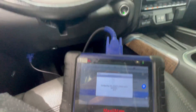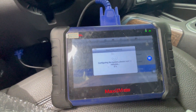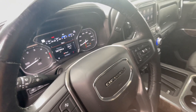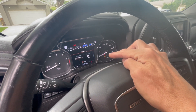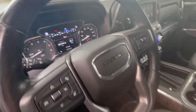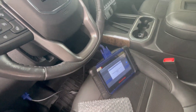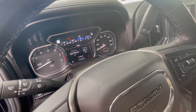The ignition is off — it's already off. And now the ignition came on without the key. We're gonna be waiting 10 minutes — it says 12 minutes but we're gonna wait 10. In the new versions you need to have internet connection all the way through, including this part of the job. So make sure you don't walk too far with your phone so you don't lose that connection.